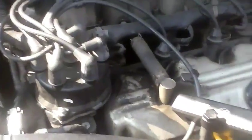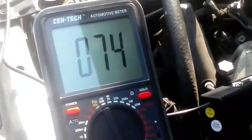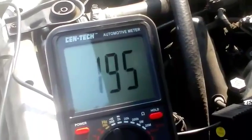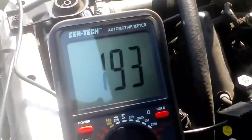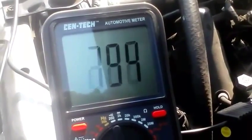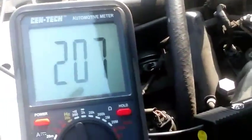There's a throttle tube right there — that's the throttle cable. I'll hit the throttle cable and you'll see what happens. It's about 2,000 RPM approximately. So the tach is pretty useful. If we've got some procedure that calls for revving it up at a certain RPM, we can use the tach to get close to that. It's revving up — this isn't going down. The little tach is well worth the money.